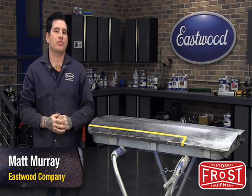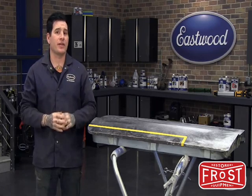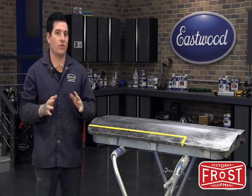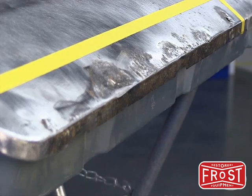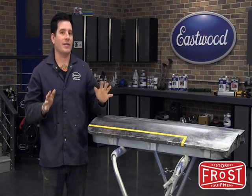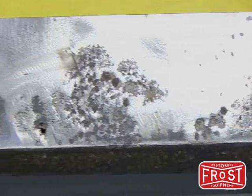Whether you're restoring an old vehicle or just doing a repaint, you can't always trust the paint you see on the outside of the body panels — especially on a vehicle that has had an obviously old paint job. This door is a perfect example. In the beginning it looked like it had half-decent bodywork and not too much damage. When I started stripping the paint down to bare metal, this is what I found: some previous repair where someone just caved and paved right over the old rust and rot.